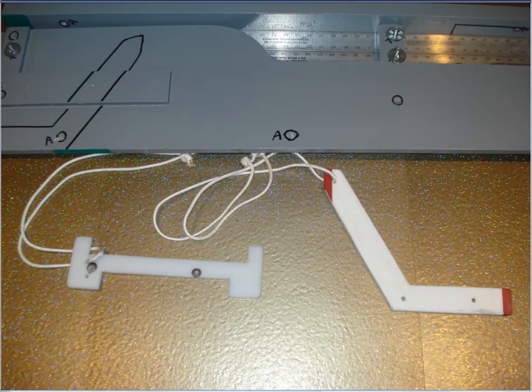These are a close-up of the gauges after they've been removed from the jig. The one on the left is for measuring seats. A seat must be longer than the minimum dimension on the bottom of that gauge and shorter than or equal to the longest dimension on the top. Sometimes riders modify their seats — they're not supposed to — but they make them too small, which would be illegal. The gauge on the right is 120 degrees and is used for measuring the morphological exemption if a tall rider's handlebars exceed 75 centimeters from the bottom bracket up to 80 centimeters. That's what we would use to make sure that they weren't too stretched out.